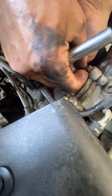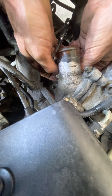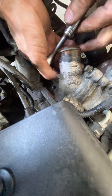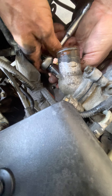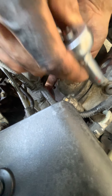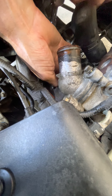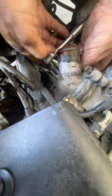Just be careful. You might want to use some spray or even work on this when the engine is a little bit hot, because the surface will expand and it will allow that bottom bolt to come out a little easier. Getting that thing out while the engine is hot might actually help it come out easier. I haven't turned this engine on since yesterday.